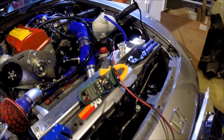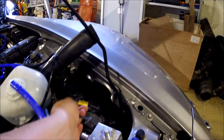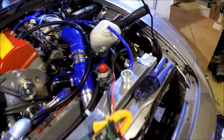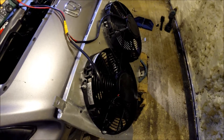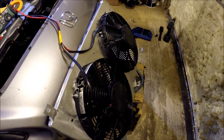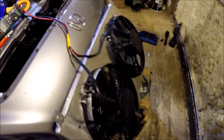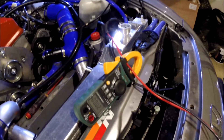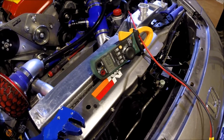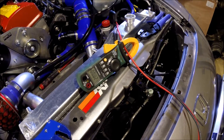I've triggered the relay to operate off the standard fan signal. That black wire goes to the relay and operates it. So basically whenever the AEM wants the fans to come on, or whenever I want them on via a switch inside the car, I just push the button and it switches on. Let's give it a test and look at the amp draw — this reading is for both fans running so you divide by two to get the true reading. My battery is a bit flat so it might not give a perfect value, but I can tell you now they are a lot more powerful than the Mishimoto.